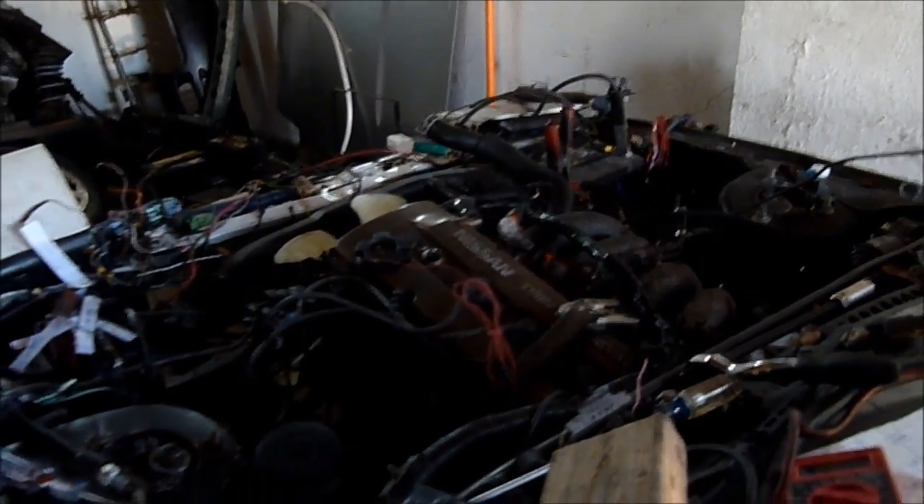I got the issue solved and it was pretty much the dumbest, simplest fix I've ever had. For your 240SX, the F1 plug — the F1 plug on the harness closest to the ECU, it's the only F1 plug. Let me show you guys — sorry about the camera angle — this F1 plug right here.